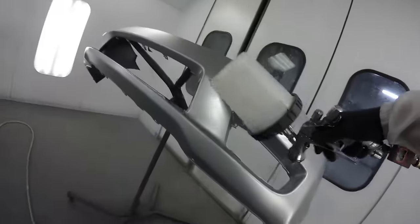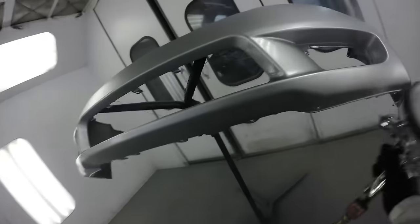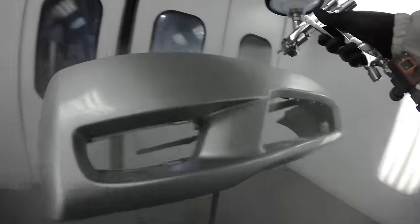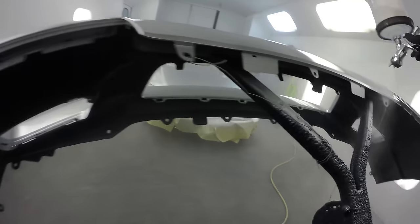Following the same pattern as throughout this job — start off with the offsets then work my way to the main part of the vehicle. We're using a two-part clear coat product with a hardener and a reducer. I've used a medium hardener here. You want to go with the biggest part of your job in mind — a fast hardener on just the bumper would be too fast for the whole front end. With a medium hardener I can do the front end and still do the bumper, but I couldn't go the other way.